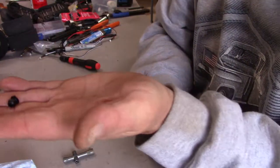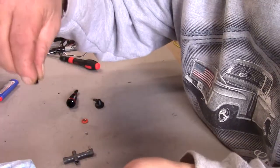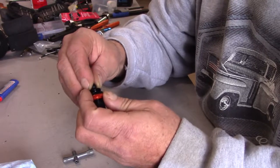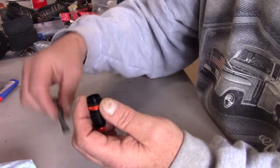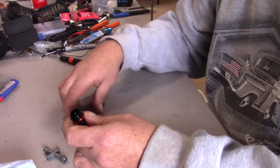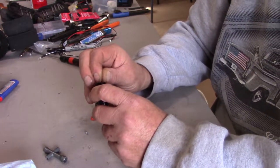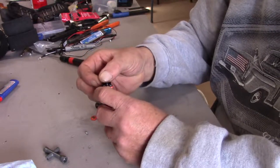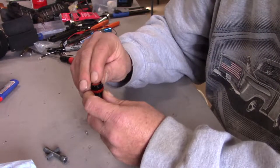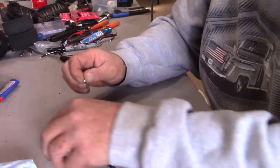You can see there's a wide part on one side right here at the bottom - that's going to go down into the bottom of the shock body right here. We'll just stick that in there and push it down, then put it all back together again. The hard part about this is getting these little tiny washers. The first one I did was a real pain - it didn't want to go together. Stick that back down on there, take the nut, put it back on.